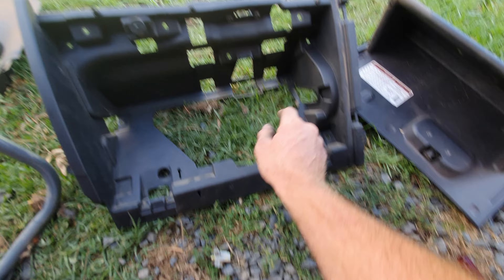I've got the glove box already out, but to remove it: open your glove box, push this down and push that down to get it out, then when it's open all the way just pop it up and it comes out. After that there are ten screws to remove inside the vehicle.